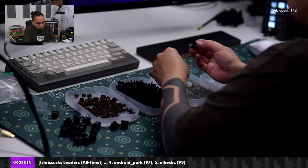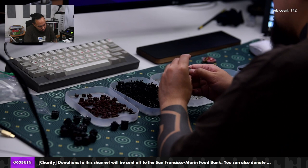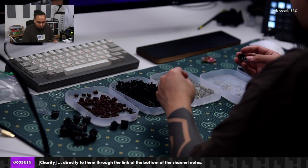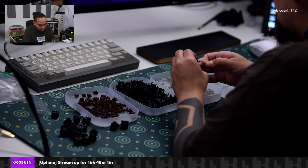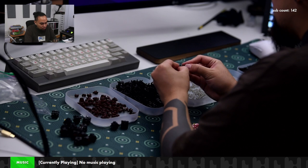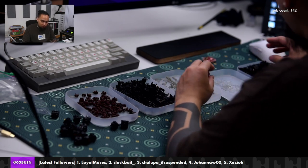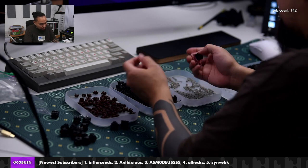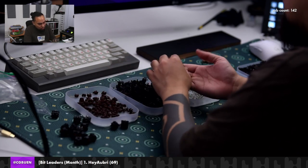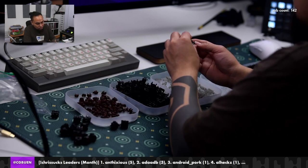Are there any lower profile custom keyboards? Ooh, that's a good question. There are a lot of different ways you can look at lower profile, and it depends on what you define as low profile. At a very basic level, KBD fans sells what they call a low profile 60% case. It still takes these types of MX switches, but the board itself is pretty low, in the sense that the plate the switches sit on is the same height as the case itself, so there's no lip exposed.